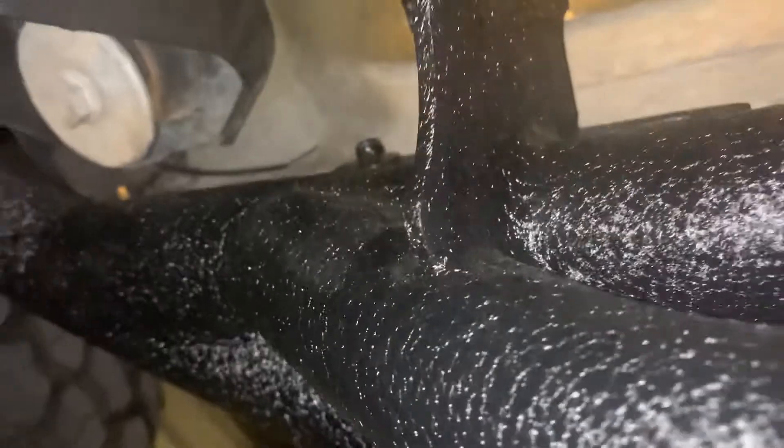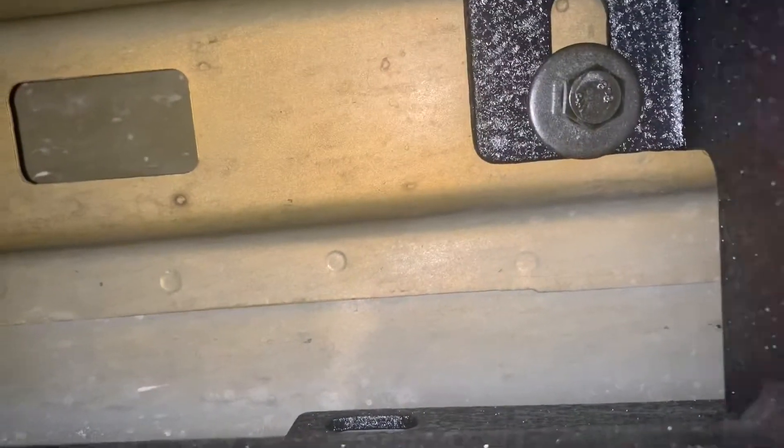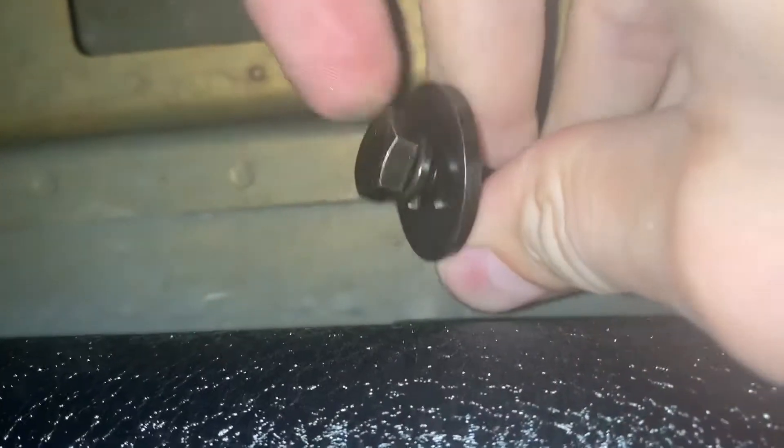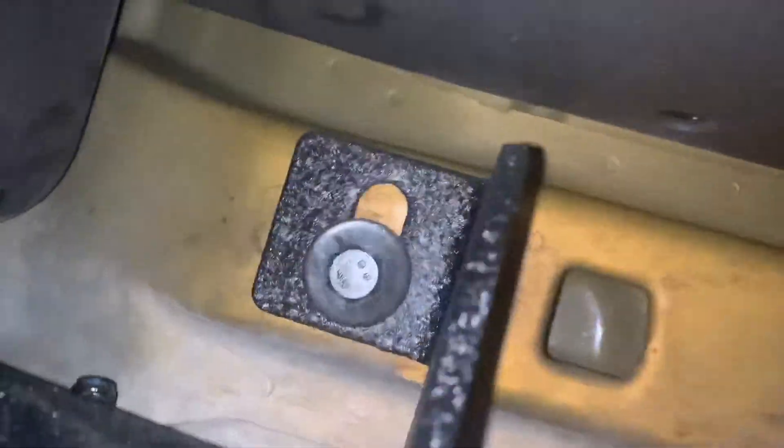You can see I've got that rough fit there. For these other brackets up here - this is probably more the load-carrying bracket - you've got 8mm bolts with a 10mm socket, and a larger washer. Those run into the threaded outer body channel. I guess these are body mount points - kind of like an outer body channel - and these just thread right into the factory threads here. This is where factory running boards or trim panels would have been mounted. So you've got these two on the underside, plus four of the smaller 6mm bolts in total.